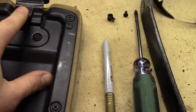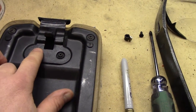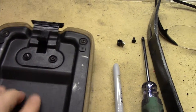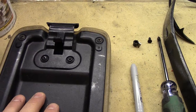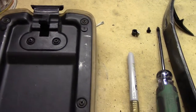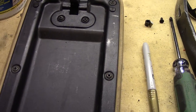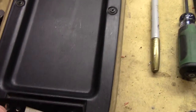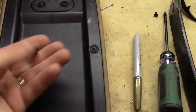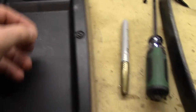If you want to mess with trying to replace latches, I don't recommend it — I think you're getting into too much work and the benefits won't pay off. The Grand Cherokee's armrest installs very solidly on the console and it's a pretty good match once you take off the flashing of the plastic and get rid of the extra bits of hinge. Here's one of those extra bits of hinge that had to be cut out — not much work.